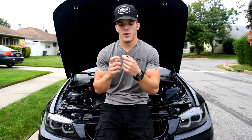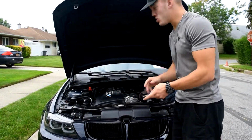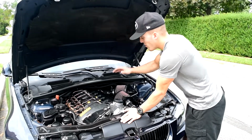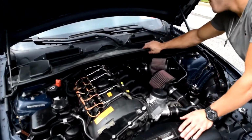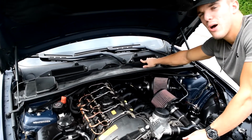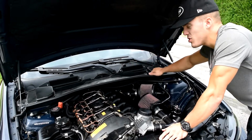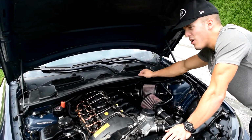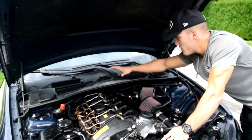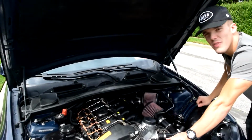So to get in with this install, the first step we're gonna wanna do is take off the cover. And the cover again is just T30 screws, two in the front and either one or two in the back. Okay, now after the cover is off, you're gonna wanna take off all of this up here. This is where the cabin filter is. But right now I just have the bottom piece because when I put in the cowl filters, the water is coming to the engine. So I have to put this bottom plastic piece back in to lead the water up to the side. But if you still have the regular cabin filter, I'll leave the link to that video either in the video somewhere or down in the description or both. But this, you just take off these caps here and over there, and there's two screws, one here, one here. I think they're 8 millimeters.